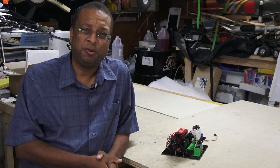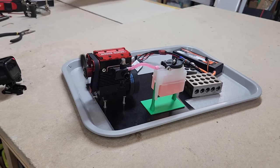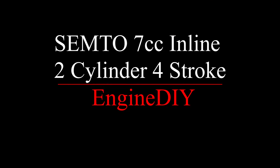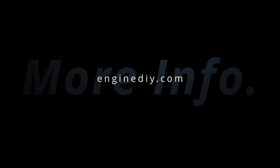Some last thoughts: I'm really impressed with the engineering of this kit. Though it remains to be seen how durable it is in the long run, it does look to be well built. The fuel I used is mostly castor oil, so I'm not surprised at the messiness, but I was happy to see oil dripping out of the crankcase. After breaking it in more, I'm likely to switch to an all-synthetic fuel which will burn more cleanly. Having the engine running on a stand is fine, but I'd really like to do something useful with it — if you have any ideas, leave a comment below. See you next time, and happy modeling!